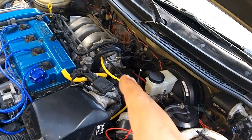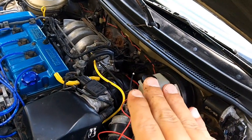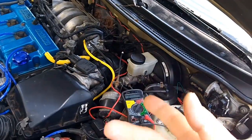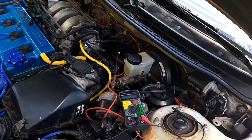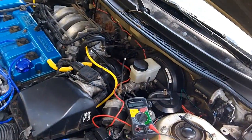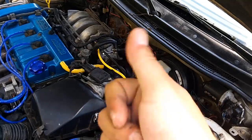So that tells us that the IAC wiring resistance is good. This is just a real quick test to see if the integrity of your wiring to your IAC is intact. That's all this test does — it doesn't tell you if the operation of your IAC is correct, just the wiring. I'm just going to keep doing all these little tests that I find in the manual, and so far my IAC wiring is good.